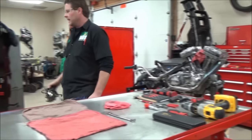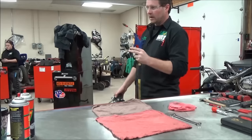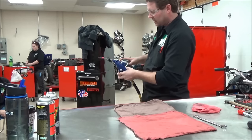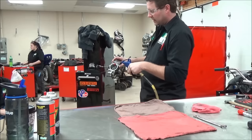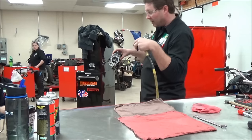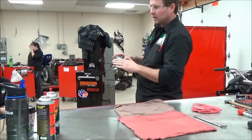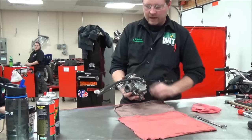I'm not going to use 90 PSI of shot pressure — I don't need that to work on a carburetor. Just a light dusting. And listen: do not take the air gun and blow really hard through the jets. If there's a piece of dirt in a jet hole and you blast it with air, you'll blow it right into the jet. When we clean carburetors, remove all the jets and blow backwards through the passages with the jets removed to clean those orifices.